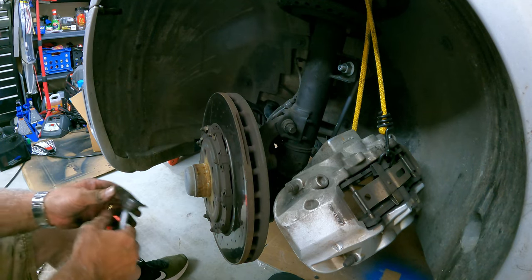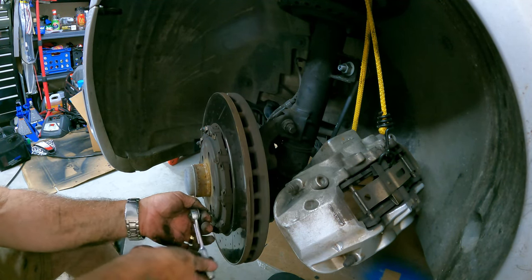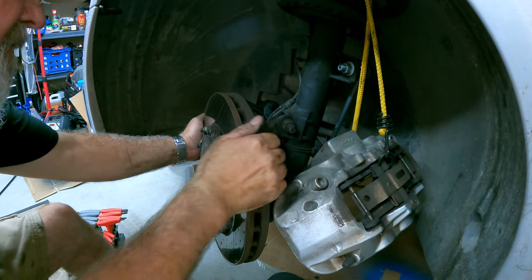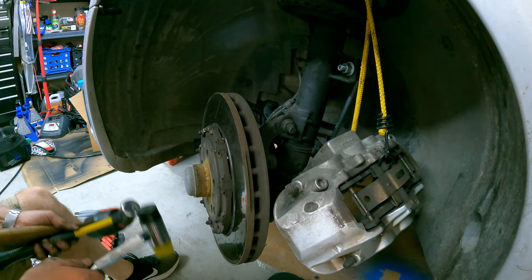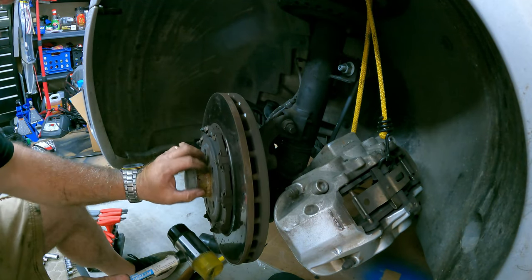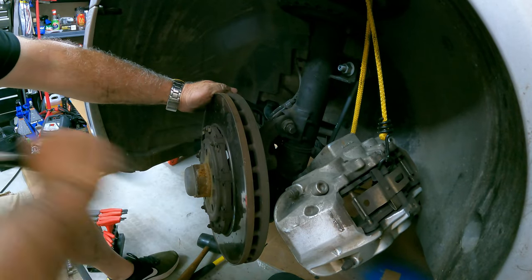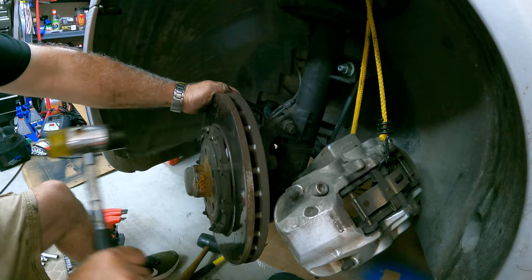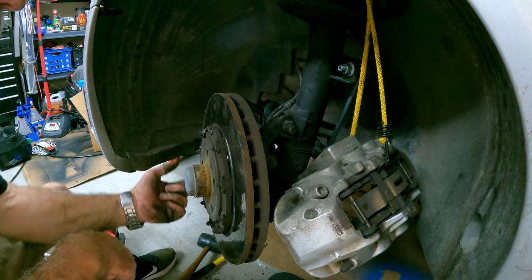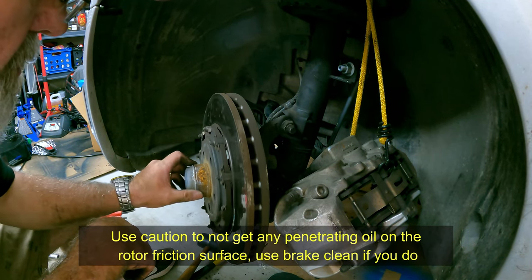Now I'm going to go ahead and see if we can pop this rotor off. It is a Torx 30, and that was really pretty easy for that one to come off. Now it's a matter of seeing if we can get this rotor off. Let me grab a rubber mallet. I've grabbed a plethora of mallets because I want to make sure I have a good one here. Around this edge it gets kind of a little bit rusty, so you kind of want to knock it loose. I'm going to go grab a wire brush and kind of clean up around this, and I might even use just a little bit of penetrating fluid to help it loosen up. But other than that, that's about all you can do — just kind of try to knock them loose.